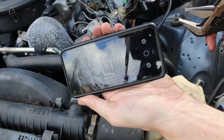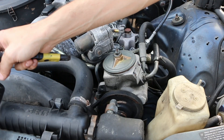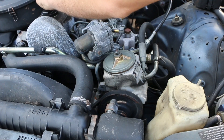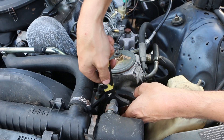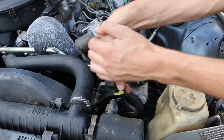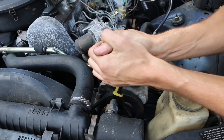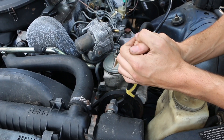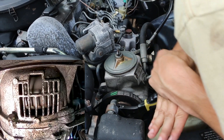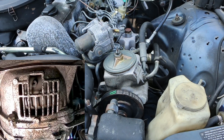I've got my phone here so that I can see the GoPro down under there. Now we're going to turn our engine over and I am using the power steering pump — a lot of people say you shouldn't be able to do this, but if you go slow you can. Just have to kind of rock it around. There it is — I got it pretty much centered. 5mm hex.